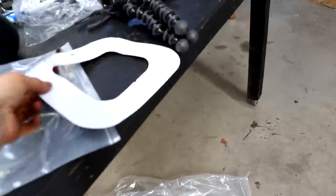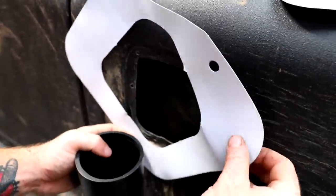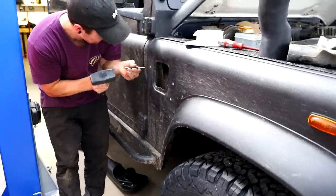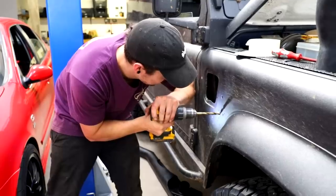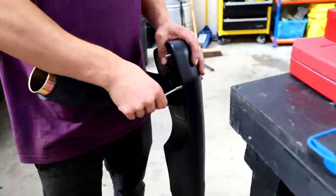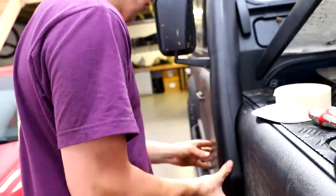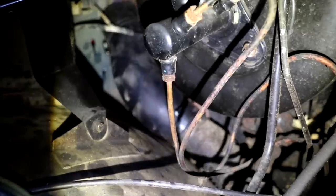So we've got to drill holes — the kit came with a template to drill holes. We put these little studs in here and they go into the holes that we drilled. Snorkel done. We've got a bracket there which is riveted — that's solid. Unfortunately a silver Jubilee clip, which I might paint. All the pipework's done under there, all tight.